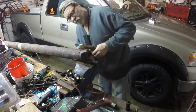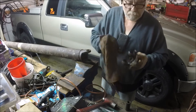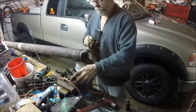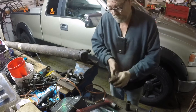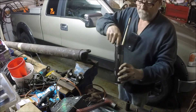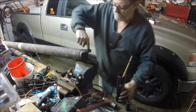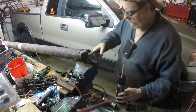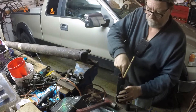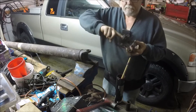I'm wondering if I should Dremel those holes or just try them first - it took me two hours to get those other ones to fit. I don't want to spend a fortune on a new driveshaft. Another thing I like to do is use regular old grease and put just a little bit inside where the caps are going to slide - just a little bit. You don't need to fill the groove, but it just helps them slide together. Anything you can do to make these slide together, you want to do it.